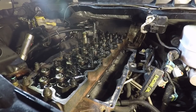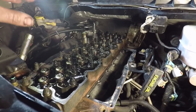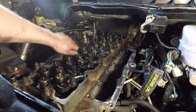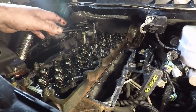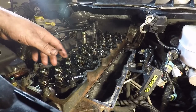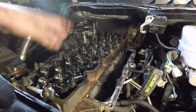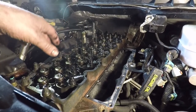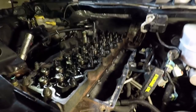I think we are ready to pull the head studs out. Rather than just zipping off the front ones with the gun, I'm going to do them by hand just so I can feel how tight they are — just to see if maybe something didn't get torqued, maybe I missed something when we put the studs in. Really I think it's because I had those big 200% over injectors in it without a proper tune, like an idiot. I do know better, and for whatever reason I slapped them in here before I could get a new tune from Ryan — and ran it like that for over a year now. I think that's what started this whole mess. I'll probably start in the center and work my way out, like your normal torque sequence. I also need to unhook that coolant line.